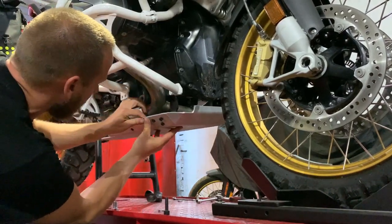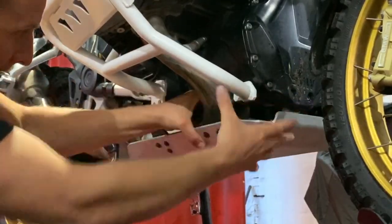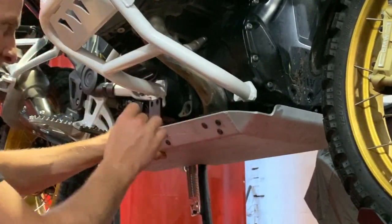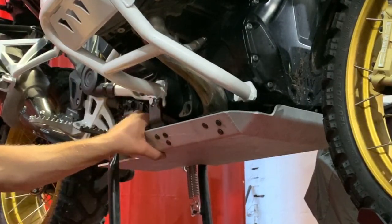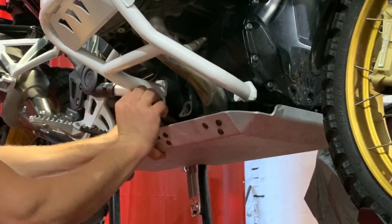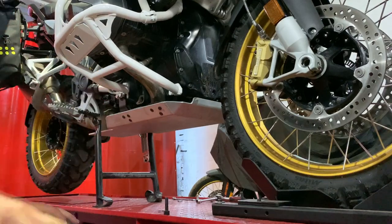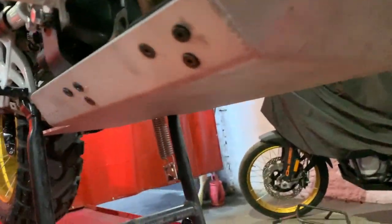Slide this in on the front, press on it — everything is looking good. Same on this side; spin the 8x20mm bolts in by hand with no tools at this point. Now here's where to put the spacer: the skid plate tab pushes right against the crash bar's tab, so obviously the spacer is going to go in here.